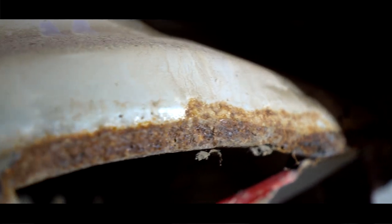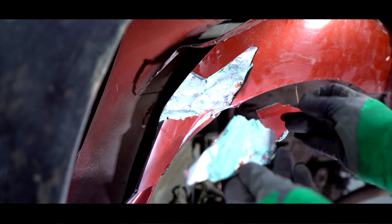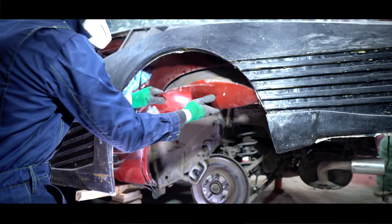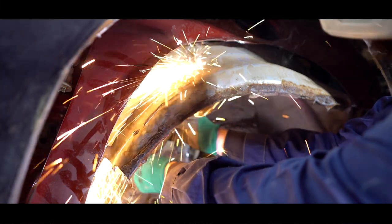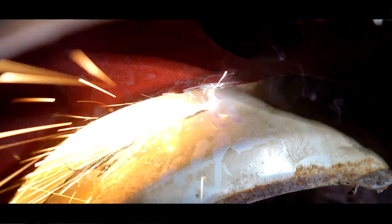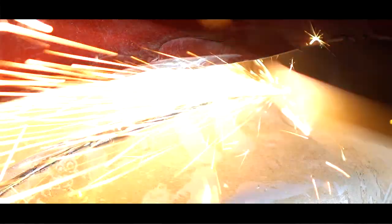There's already strong corrosion in some places coming through. Well, we also need a thick layer of putty. Then I began to saw the underwing itself. I made the cut a bit lower so it'd be possible to pack the arch again.